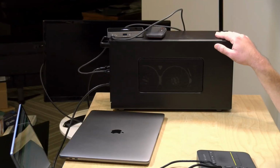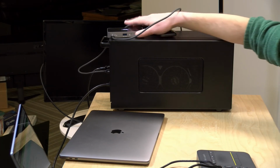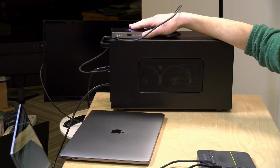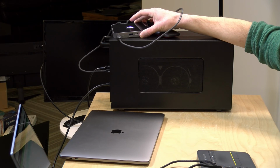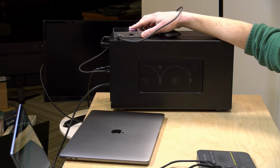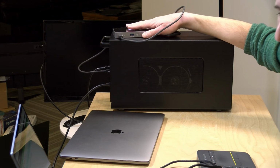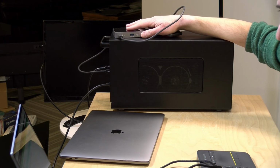Well, I'm glad you all enjoyed the stream. This was fun. Again, this was just one of my work sessions where I was checking stuff out, and it seems to work pretty good. We confirmed a couple of things. One is that you can use eGPUs with it. It will share the bandwidth. There'll be a little bit of a performance hit if you're really whacking away at the drive at the same time, but that worked. We need to figure out why we weren't getting the aggregate bandwidth of both of those drives when we had them as RAID 0, and I may just email the guy at OWC tonight about that.